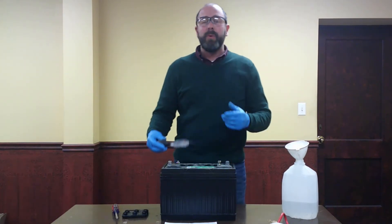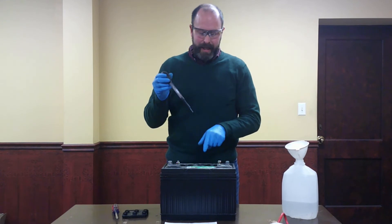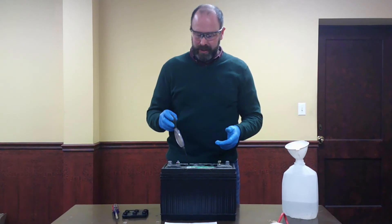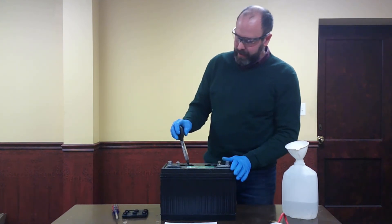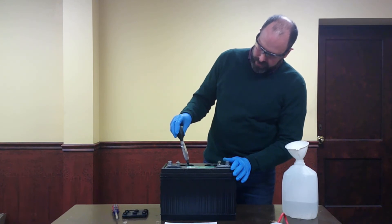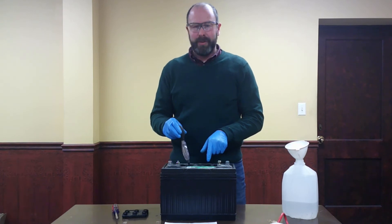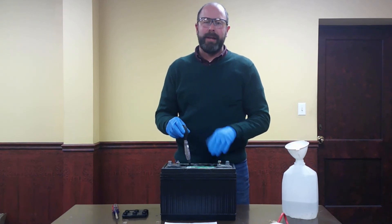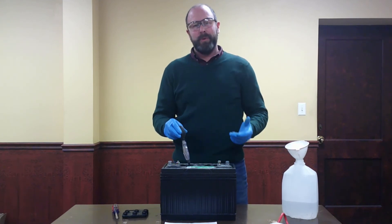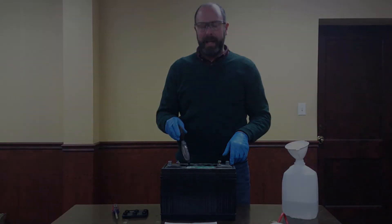One tool that anyone could have is just a little hydrometer. You can check cell by cell what the health of each battery cell is. You stick this down into the cell and suck the water up, and it's going to tell you — for instance, this one shows fair, almost on the good range. I just checked another cell and it shows bad, kind of in that bad range. We know that this battery needs the whole pack to be working, so if you have one cell that's bad, unfortunately the whole battery is probably on its way out.